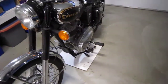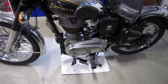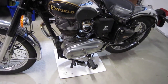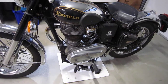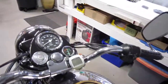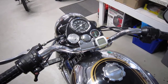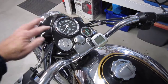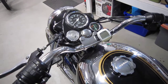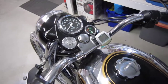The big job this year is I'm going to take off the cylinder and the head. I want to clean up the rust on the outside of the cylinder, repaint it, clean up the head, and check the seats — if I have to lap the valves in, I'll do that. The big thing I want to look at is the piston. The bike reads about 15,000 kilometers on the speedo, but since the speedo's always read high, it's probably closer to 12 or 13,000. I've heard a lot about the pistons having a problem with the skirts separating at the bottom, and this is the original factory-installed piston. So I'm going to take it out, measure it to make sure it doesn't need to go up a size, then order a new forged piston from Hitchcocks in England.